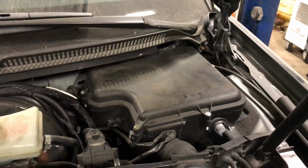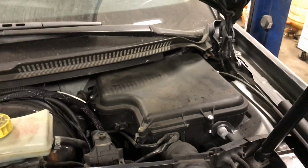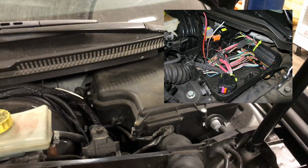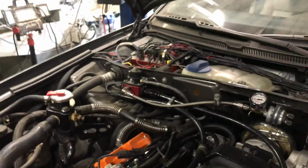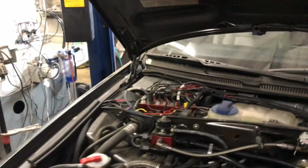Brake servo. This box here is the factory Audi ECU enclosure. I do retain the factory ECU, but it was modified by my friends Nate and Javad over at 034. One of the problems of doing this LS swap into the Audi is getting all the instruments and the ABS and everything else to work. Speaking of ABS, so the way I did this is that the engine is actually controlled by a GM ECU, and I tune it using HP Tuners, and the GM ECU is hidden up under the dash.